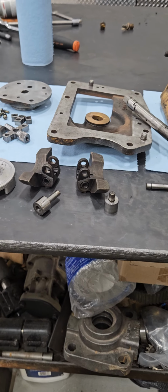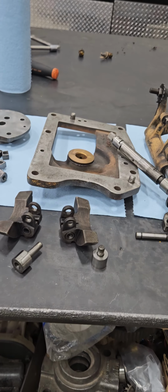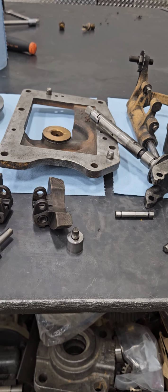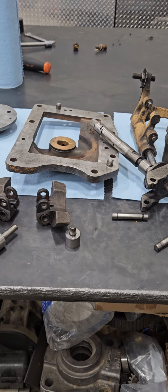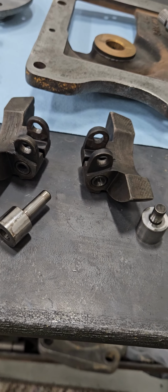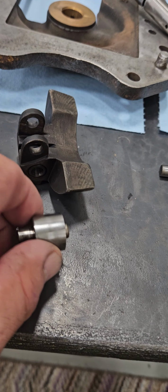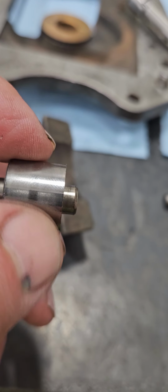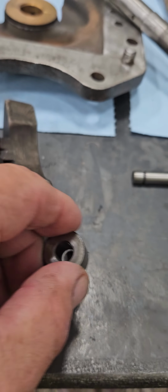So apparently I am the D9 Whisperer. This is the governor off Killdozer, and it was surging. It's been doing it for quite a while, but I had a feeling I better take it apart. Didn't want to, but it's a good thing I did, because these are the rollers that go on the governor, and this one is flat spotted really bad.